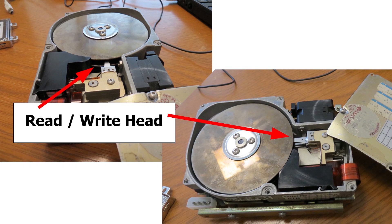There's actually supposed to be another read-write head on the top, but that got bent off and broken during one of our demonstrations, so it's no longer with us. Basically, the tip — which is underneath the disk — is where the magnetic read-write head goes. That whole assembly moves in and out. By moving it in and out and spinning the disk around, we're able to access every individual part of the platter, magnetize it, or read how that section of the disk is magnetized. That's how we store our bits on this type of device.